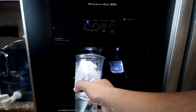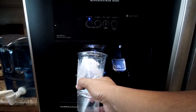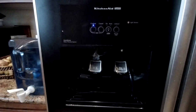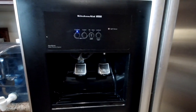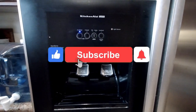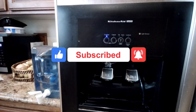There are different reasons for this issue. You can have an issue with the motor assembly, ice maker not producing ice, ice bucket not seated properly, or the most common issue is the freezer temperature getting warmer, causing the ice to stick together and getting stuck, preventing the motor from turning.